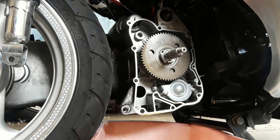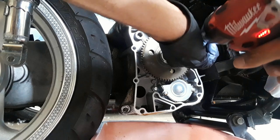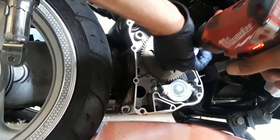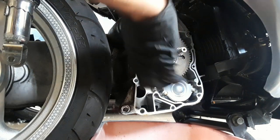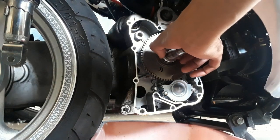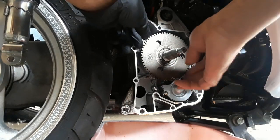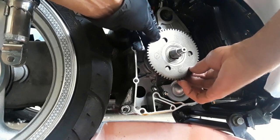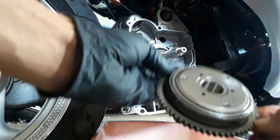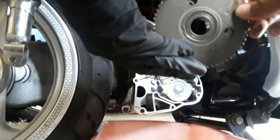Now we're going to pull the socket off and use our castle nut. On this one it is righty to loosen, so we want to make sure we've got our drill going the right way. Place it on and it spins right off. We take that off, and there's a socket that holds it in place. I'm going to slide this bad boy on out now. And there's our culprit. Let's get a new one in there.